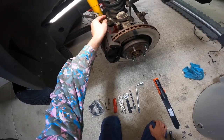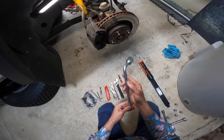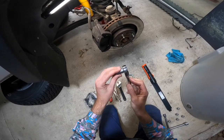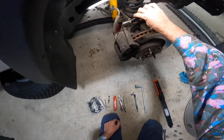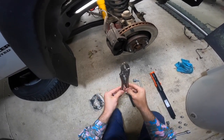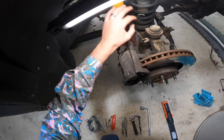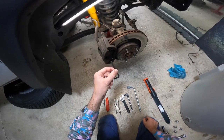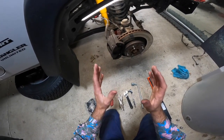To get to your front speed sensor on your JK, you'll need a 24mm socket — I didn't actually have one so I'm using a tire iron out of my wife's Mazda CX-3. You'll need a ratchet with a 13mm socket, an adjustable spanner for this section here, some vice clamps which will definitely come in handy, a knife to cut the cable ties holding the wheel speed sensor, and an allen key which holds the speed sensor into the hub.